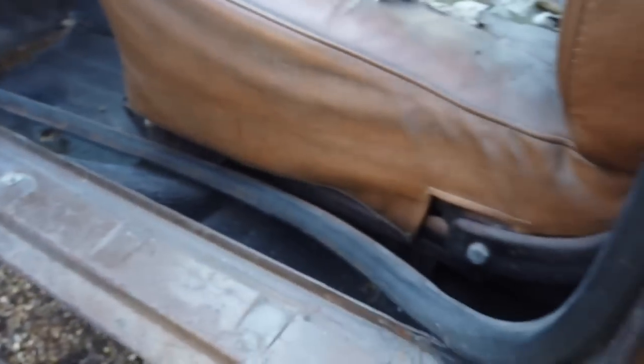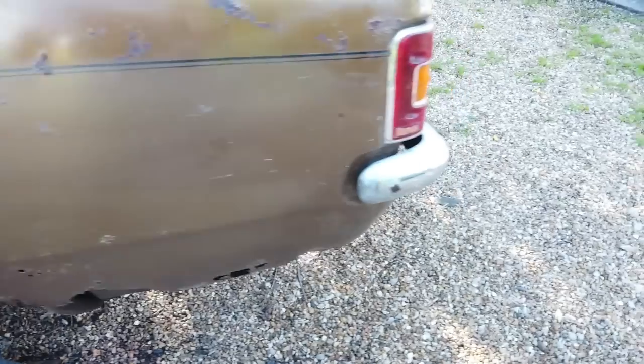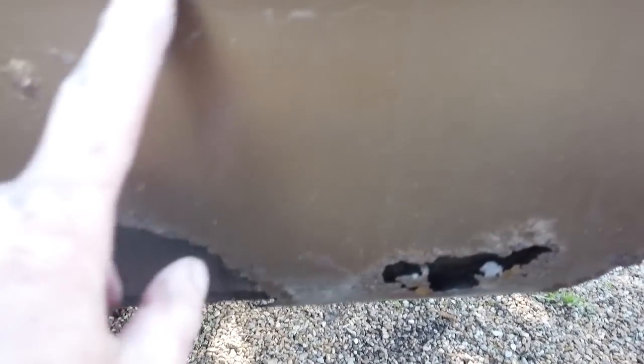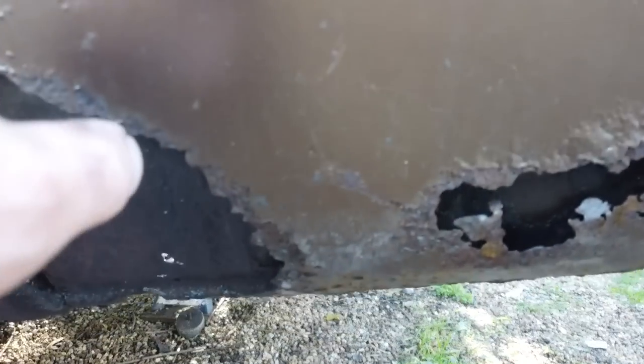Doors are all cleaned and wax oiled now. That'll keep the rust at bay for a bit. B pillars have also been injected. Started cleaning the boot floor area up. Those quarters that we're going to be getting come in to that swage line, just about in where the rust is, look.